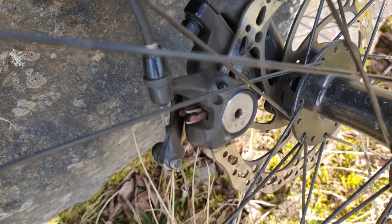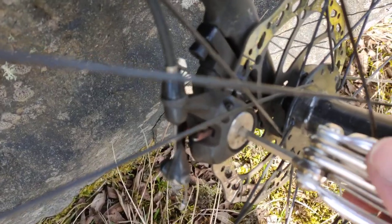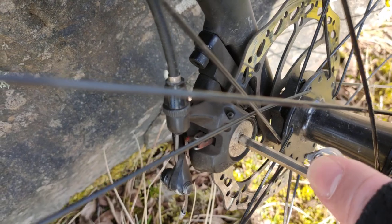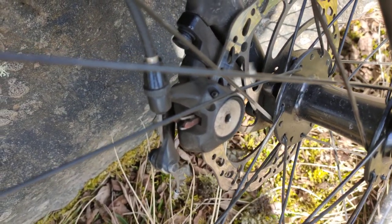It's probably the brake pads. What you'll need to do is look at the V-brakes — it uses brake pads — and usually a quarter turn will do it. Not too much, because then it'll be rubbing against. But this has got brake pads in it, same as V-brakes.